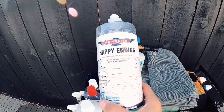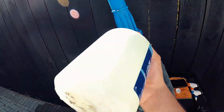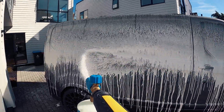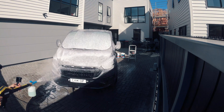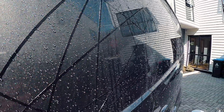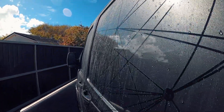The next step is Bowden's own Happy Ending. This is a super hydrophobic sacrificial sealant that lasts roughly around six months. It's super easy to apply — all you have to do is connect it to your water blaster, spray it on, wait 10 seconds, then water blast it off. It's got super simple instructions on the back so make sure you follow those to minimise streaking. The ratio is 900ml of water to 100ml of product, so it's another great value for money product. If you're doing this in the sun, make sure you do it panel by panel to minimise streaking and make sure the panels are nice and cold. Another real perk of Happy Ending is its gloss factor — it makes everything super glossy as well as being a really super hydrophobic sealant. Just look at the results — you can see how glossy everything is. What a reflection!